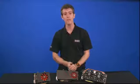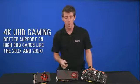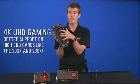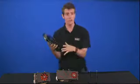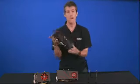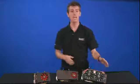Ultra HD 4K gaming will have better support on the high-end cards, with particular emphasis on the very high-end cards. With that said, the 280X is not going to be a slouch — it does have 3 gigs of memory, making it optimal for 2.5K gaming with very high-end titles and 4K gaming with slightly older, slightly less intensive titles, since it's going to be pretty similar in performance to the outgoing 7970 GHz edition.